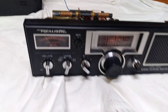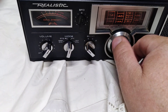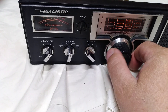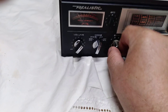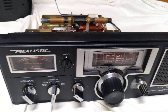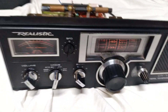As you rotate here — I like to put a rag down so you don't scratch — but you can see it's working. I don't have an antenna and I'm in a metal building, so AM is not going to pick up very well. This is your fine tuning, which also didn't work when I got it — now it does. There's your band switch, there's your mode switch. None of that worked before. It's because all the potentiometers and the band switch are filthy, especially if it comes from a smoker. That cigarette smoke gets in the radio, gets on those pots — it's like a magnet — and the two mix with the grease. Next thing you know, they're corroded and nothing works. So now she's working.